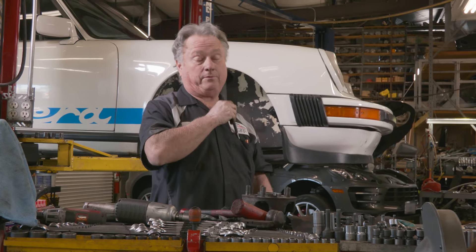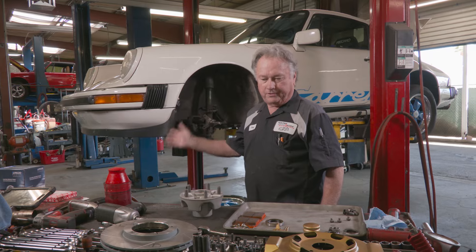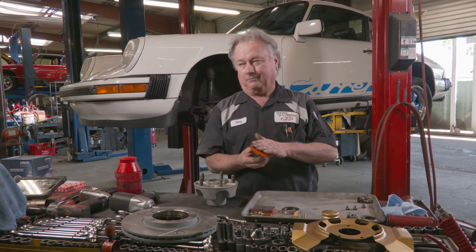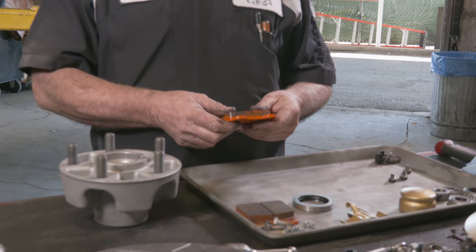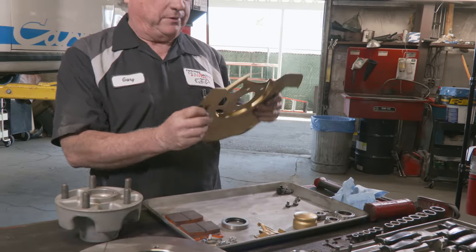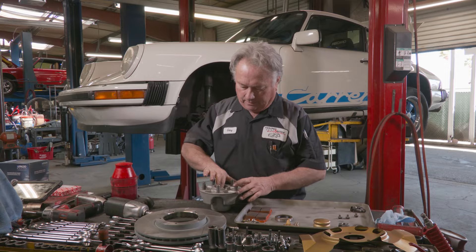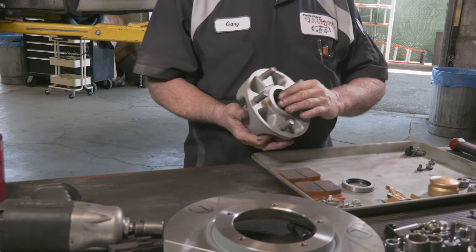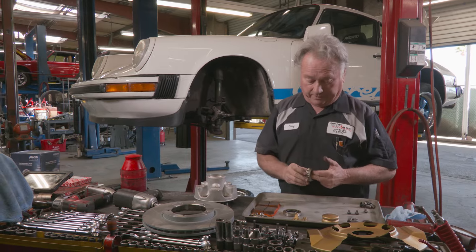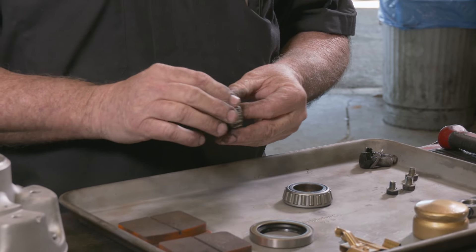Now we can go to the side I've already got cleaned up. The right front I just took apart — the left front I took apart the same way and cleaned up. You can see the difference. These are the Pagid Orange pads — real obvious. They're a much harder compound, great for tracking. Now you can see the backing plate I took off looks a lot better than that rusted one. We're going with slotted rotors — they have the cooling slots and they're directional. I checked the races: no pitting, no funny grooves, everything looks really good, and the bearings are also fine despite the signs of water. Everything is reusable.